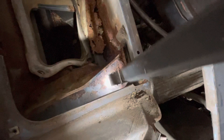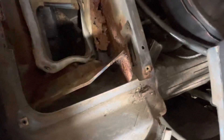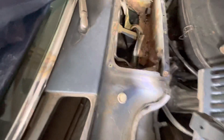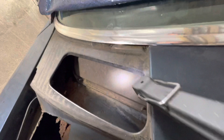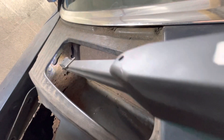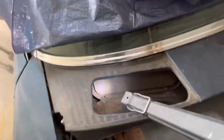That can be tested reasonably well just by taking the cover out and pouring water in — it should pour away. The other way out is the other side, because water that falls more towards the outside of the car will flow the other way, down that slight curve of the chamber, and it's supposed to just fall over the edge and go down the side of the inner wing.